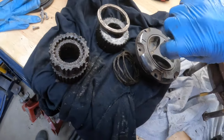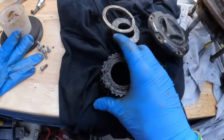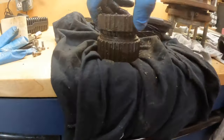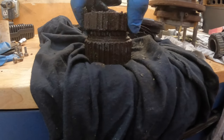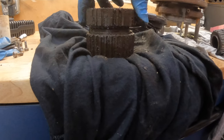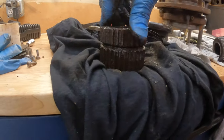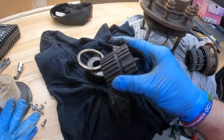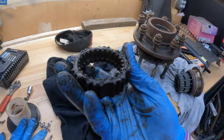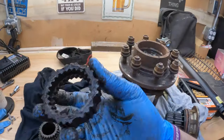When you turn this to the lock, what that does is it seats this down all the way. If you can imagine, just like when it's unlocked, this is what's happening. Just like this, it'll free spin. Then when you push pressure on it, it finds the teeth, meshes, bam, and locks in. And now the axle shaft is connected to the hub. But if you look, this is all that's driving power. And this is fine if you're probably